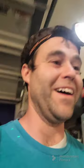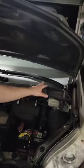And then mounting the hitch itself, I did it by myself. It was the most awkward thing ever. It was super difficult physically to get that up in there. So if you do have a second person just to hold it while you're mounting it, do that. And then to torque the bolt, I think it's down to like 79 foot-pounds, I believe it is. Check your specs on your vehicle on that though. And overall in theory it's a pretty simple process. The hardest thing, like I said, is feeding the wires underneath the car.